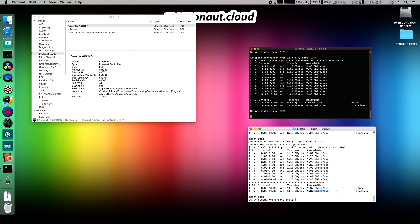Almost full 10 Gigabit! Of course the overall speed depends not just on the network card itself, but also on the speed of your disks. Most importantly, use a proper Ethernet cable. I personally use and recommend CAT 7 Ethernet cable, which will give you 10 Gigabit speed over long distances — this cable is in fact 30 meters long and look how great it performs.